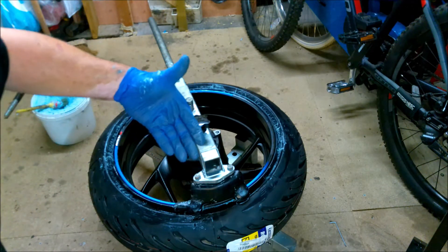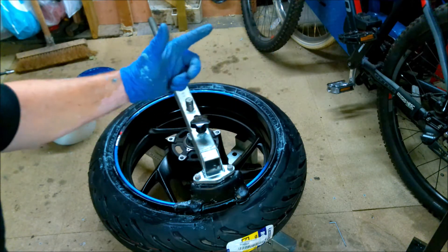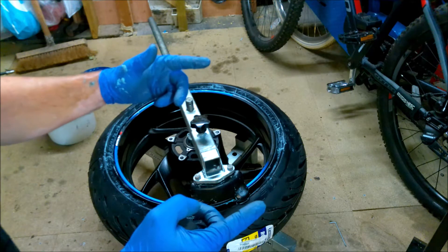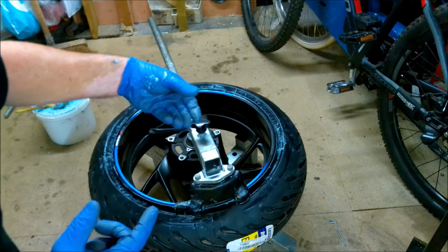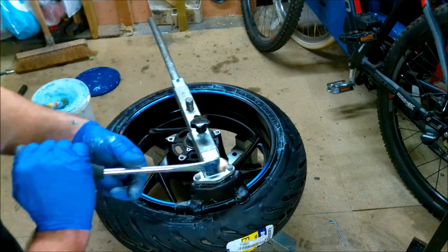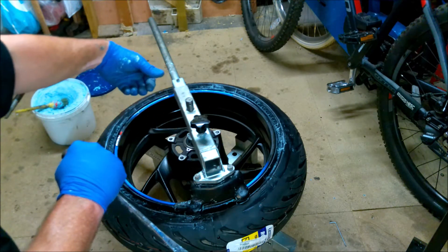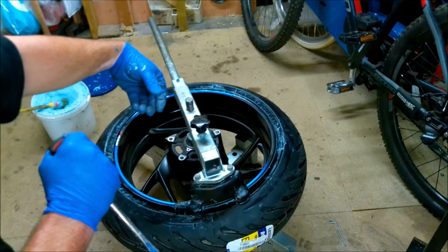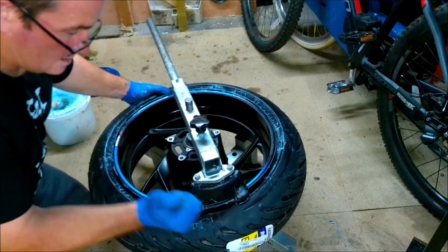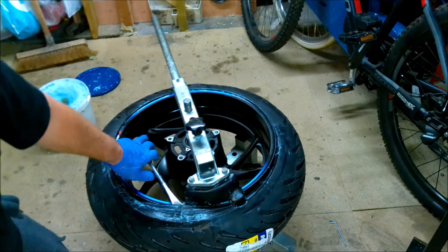With this, because you're doing the far edge - if you squeeze the tire and push it in, it just fits in because your wheel is that shape. The outer bead being the widest diameter, the middle inner being the smallest diameter. If you squidge your tire and push it into that it will give you more room this side and make it a lot easier even with these little tire irons. Just clamp it top and bottom and push it into that middle dip - easy as that.